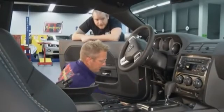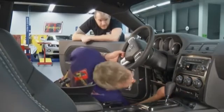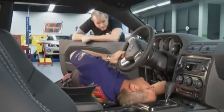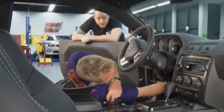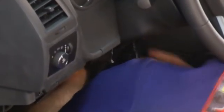Now you're going to want to reach up behind the ignition switch and disconnect the connector there. Okay, right up in here. Then you should be able to pull the pigtail down. All right. Oh, yeah, there it is. Okay. All right, now that pigtail will go into my harness. That's correct. You just plug it into your T-harness. There we go. All right.